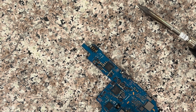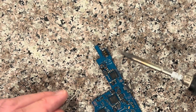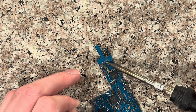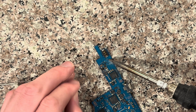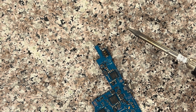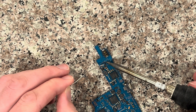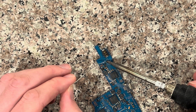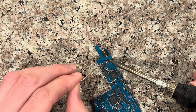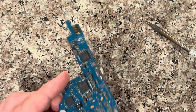If you want to bridge these two points right here, I typically don't bother with wire unless you already have one. Add some fresh solder at a higher temperature to these two points, then drop your temperature down to about 210–220 degrees Celsius. Slowly add it in, pulling the solder away, and you're just going to slowly bridge it as the solder cools down. And there you go — that'll fix that issue.